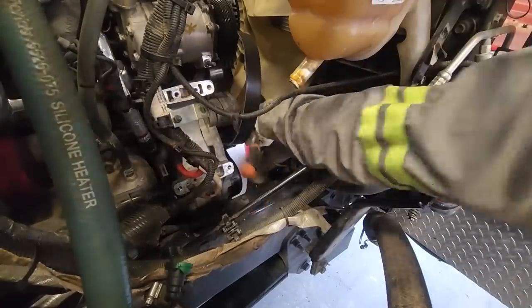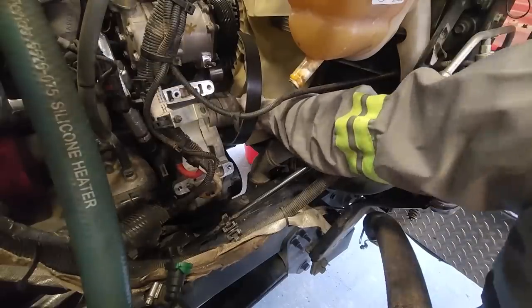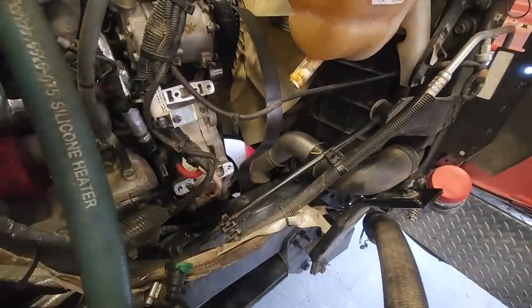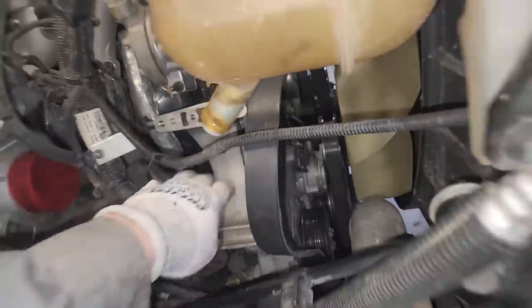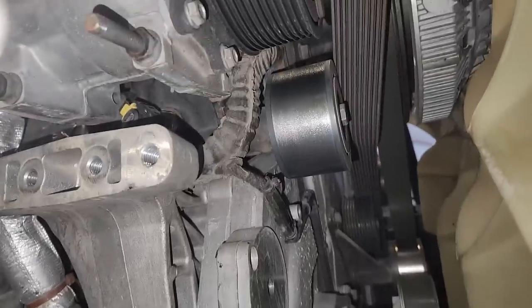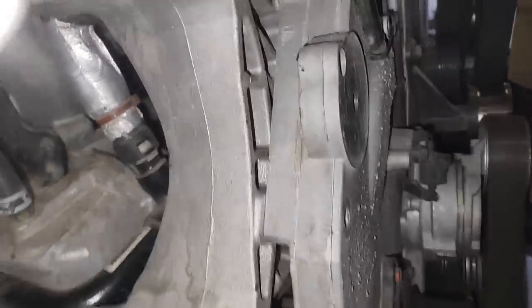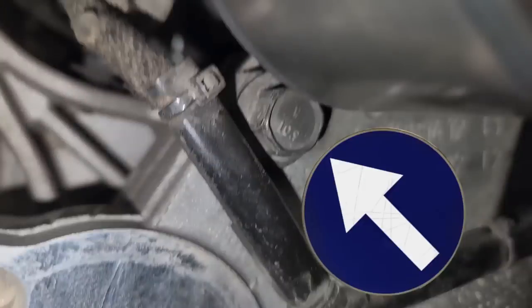Now what I'm doing here is pulling the tensioner off, because that bracket that holds the alternator on has some bolts that hold it on and they go through the front structure. This big piece of aluminum blocks the hoses there that go to the EGR cooler. I took the tensioner off and one of the bolts out. Now you can't really tell how many bolts hold it in, but I'm going to show you where they are. Here's one of them - it's in a bad spot, behind the wires and also behind the idler, which means I have to pull the idler off just to get to that bolt.